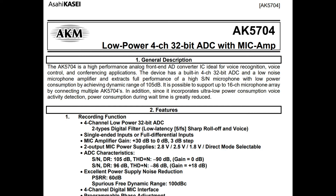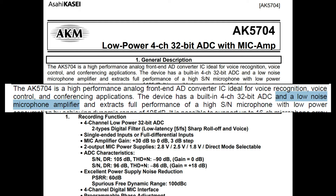Well, we have a clue in the specs. The characteristics for input jacks 1 and 2 are different from jacks 3 through 6. This tells me that they are not using the OPA1678 op amps. Going back to a datasheet that I kind of glossed over — the 5704 has a built-in microphone preamp, and it can also supply plug-in power. So why not use it? I'm not familiar with these chips, so I'd be very interested to hear your thoughts in the comments below.